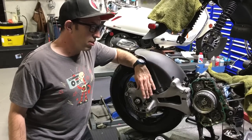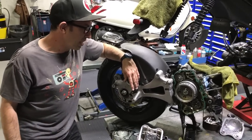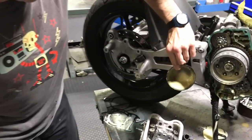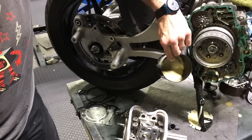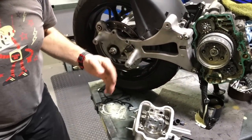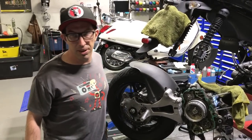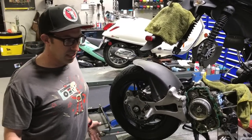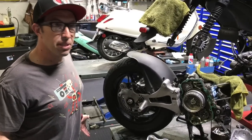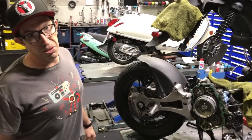The motor wasn't run too long with this cocktail of coolant and oil, but that's something that can happen if you don't take care of the coolant system. Not to pick on Piaggio products, but the coolant that comes in the bikes from new is not the greatest stuff. After about five years, the rust inhibitor factors of the coolant don't seem to work so well.